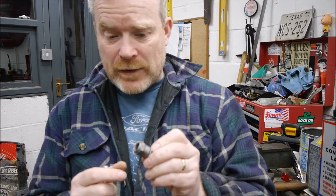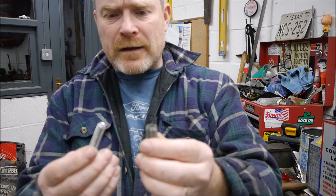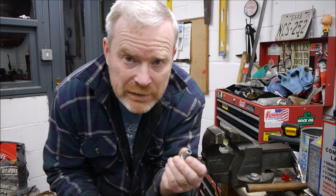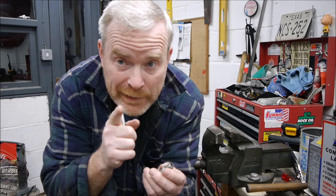I've smashed the hell out of that and got the ceramic out, so I've now just got the body. You can see that's a tight fit in there - that's an M10. What we want to do is just drill this through clearance for an M10, which I think is going to be something like 9mm. Let's run a 9mm drill through this and then put a tap through it and see how we get on. The tip for future: don't balance your camera on the bench when you're smashing something with a hammer. It's now on a tripod. Smashing the ceramic out was a lot harder than I thought.